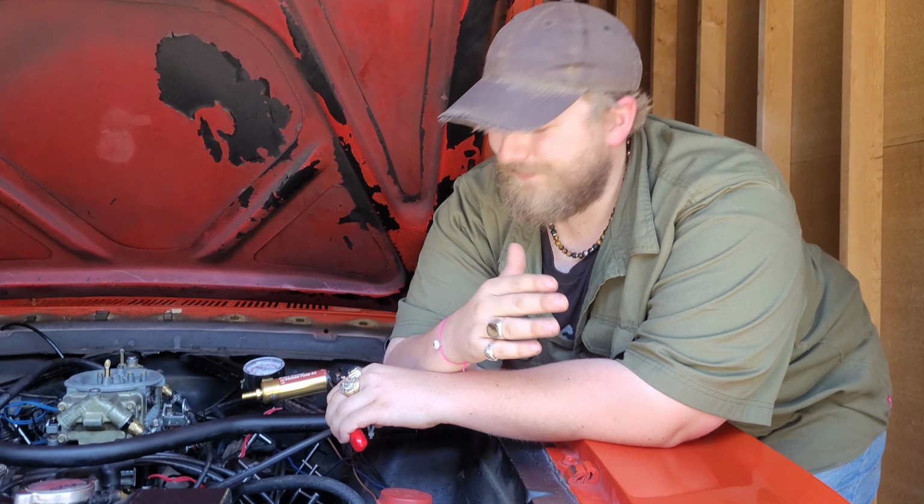Because we had 69s and 74s to start with, it was a bit lean. So then we jumped up to 72s and 78s. That was just a little bit too rich from my senses at the time. Well, then we come to find out that happened. So I fixed that, put 69s back in the primaries just to see. It's way lean now. It was pretty impressive last time though. So got good hopes for this.